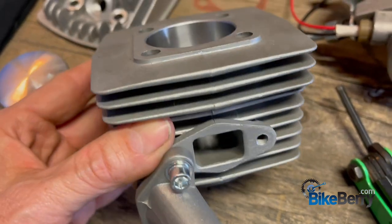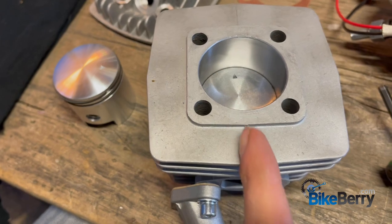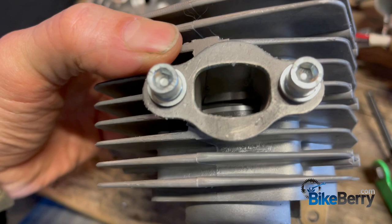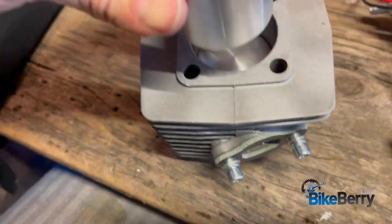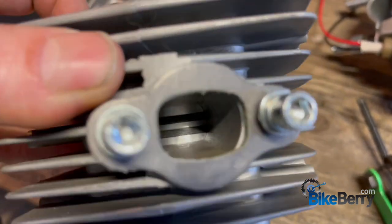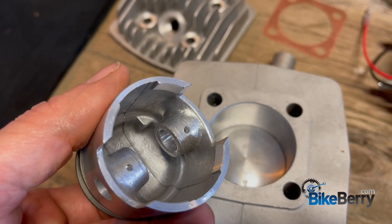Let's see why that matters where those pins are located. If we look at our intake side, it's right in the center of the housing. If we look at our exhaust side, it's offset in the housing. If you see our rings in there, we don't see any pins. If this is flipped around with those pins on the exhaust side, then that would leave a gap in that ring and that would wreck that ring. So don't rely on the arrow — rely on where the pins are and then you'll get it right.